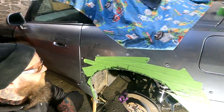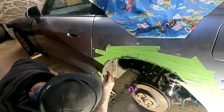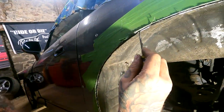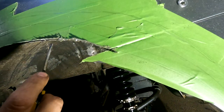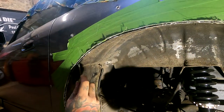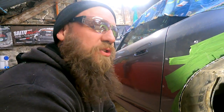I'm going to cut the outer skin, just the outer skin. Where it's kind of apart anyway, look, you can see it. Outside skin, that's all we need to be doing. Yeah, that's all free. So I'm going to cut that other bit, and then I'll show you what I've done, and then I'll show you the next bit, and then we're cut out ready for welding.